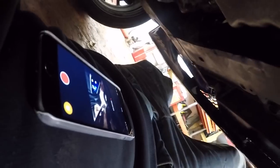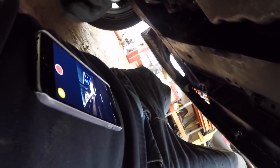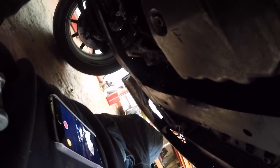Then you slide the end of the column off. It just lifts off and it's away. That is your bolt there. As you can see, there's its shape and 13mm on the end. So next we go inside and pull up the carpet and everything. Get the torch out there before I leave that behind.